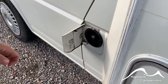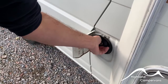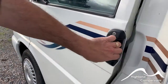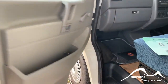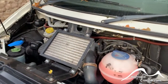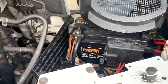Fuel filler cap — the outer flap is not affected by a locking system but you have got a cap, so ignition key in, turn the whole lock over 180 degrees and then unscrew the cap to fill with diesel, and then vice versa back in — wind the cap on until it will turn no more, then turn the key back through 180 degrees and it should lock into position. To get under the bonnet you've got a bonnet release at the top of the passenger footwell — pull back firmly on that lever. When you do that it exposes a little red tag just above the Volkswagen badge, push in on that one and that should enable you to open it up. Bonnet stay up and then you have your screen wash, power steering fluid, oil filler, oil dipstick, brake fluid, radiator water, and the engine battery over on the right hand side underneath the filter intake.